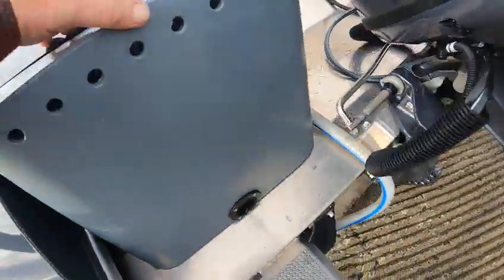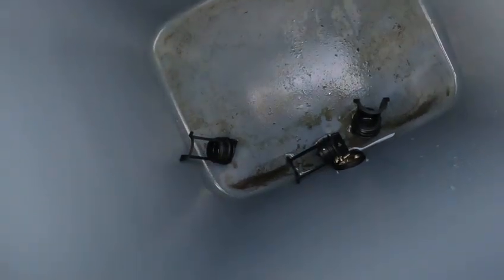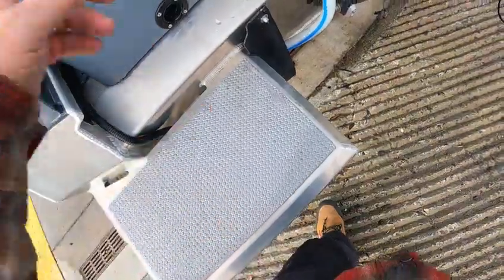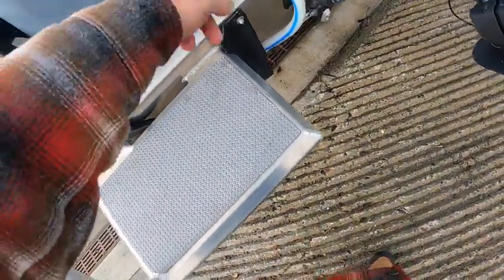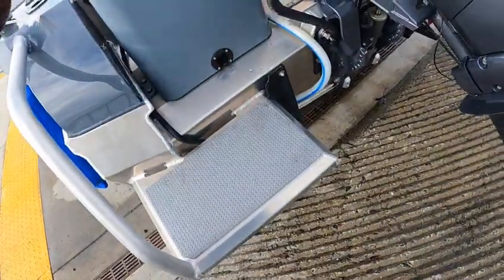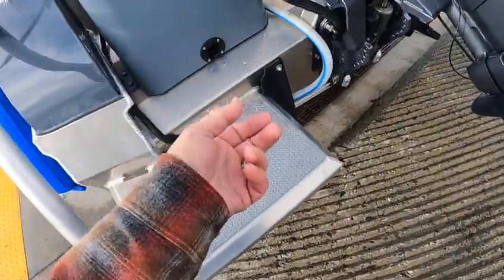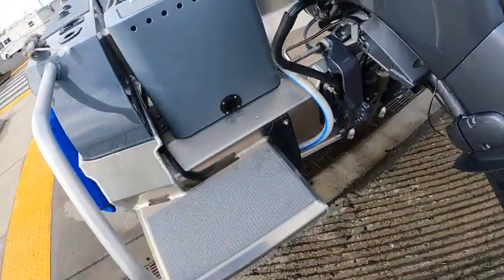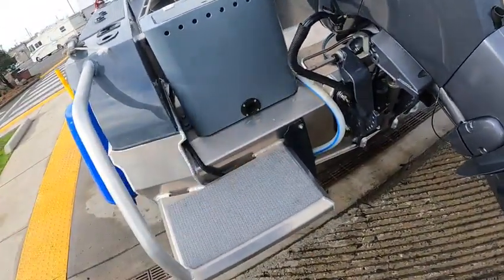There's a drain here — there's a cap in there. Those other two caps go on the inside. If you want the self-bailers left down, you can cap them from the inside. If you leave them down and just sit in the boat in the back, they can put water inside your boat until you get going, then they drain. If you don't want that, use those plugs and plug them back there.